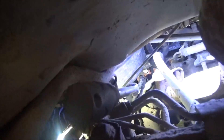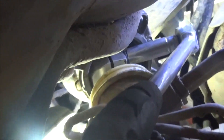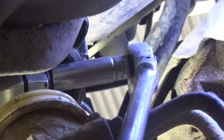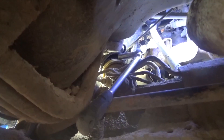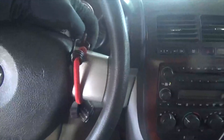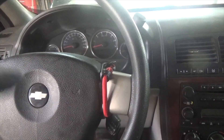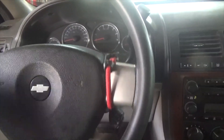It really helped to rotate the shaft around so that the bolt would be on this side — and it's an 11 millimeter socket, really weird. With it in the straight ahead position the bolt is on the opposite end, so rotating it lets me break it loose. Once I get that loose, I can put it back to the straight position before taking the coupler off the rack. Make sure your wheels are straight, and I like to tie off the steering wheel so it can't go spinning, because if you have the shaft disconnected from the rack and you were to spin the wheel, you could actually break the clock spring — it should only rotate a certain amount to the right and to the left.